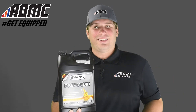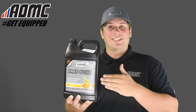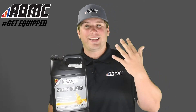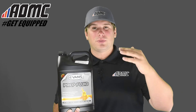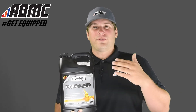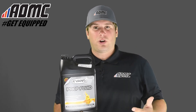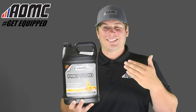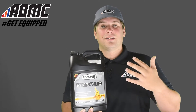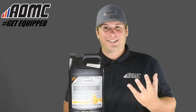It is not intended to be a standalone coolant. This isn't a coolant — it's waterless, but it's not a coolant. It's not built to withstand freezing or boiling temperatures the way Evans waterless coolant is. Evans waterless coolant is rated to 375°F boiling and negative 40°F freezing. This prep fluid isn't designed to perform under those engine stress conditions.